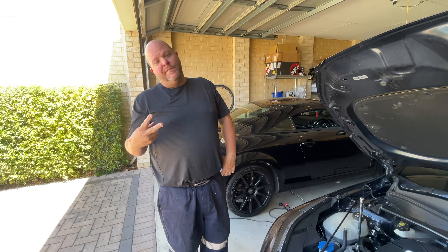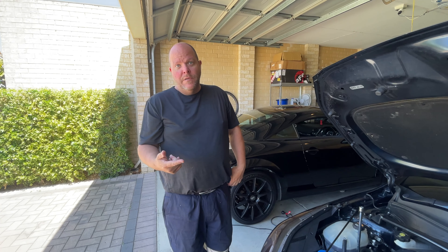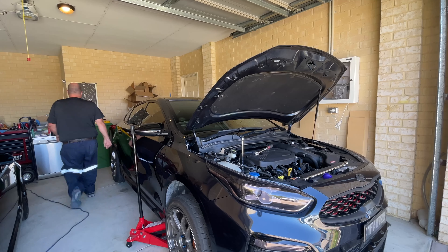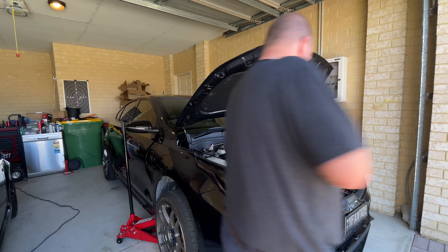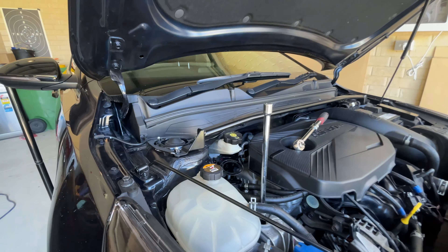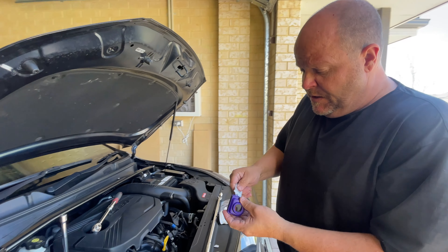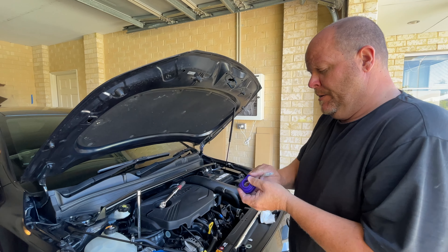This is why we're supposed to have two people here doing this. When I take the nut off the engine mount, the engine's going to drop lower in the car. We now have two jacks under the car — one of them is under the oil pan just to support the weight of the engine, to stop it dropping as we remove this bolt. Good idea to get everything ready before you take the bolt off.